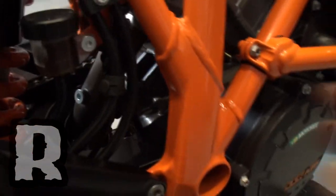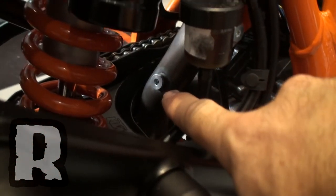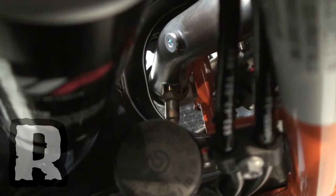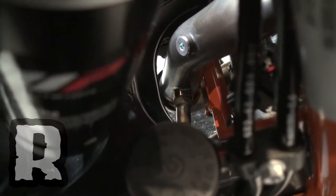For the auto-tune, we plugged in the wideband O2s. We plugged the stock O2 sensor and then welded a new bung down on the bottom — you can see it right there. It matches the length coming out from the header port a little bit better to the front cylinder, so you get better AFR readings, and it also hides it down there. One note: I'm kind of wishing we angled it a bit more the other way because it gets near the swing arm. If you point it more in that direction, it'd be a better deal.